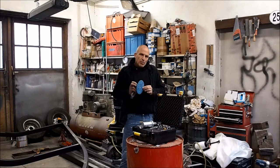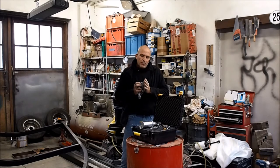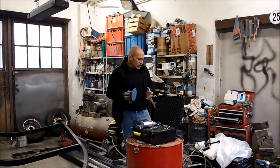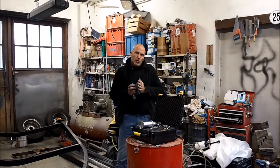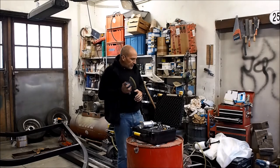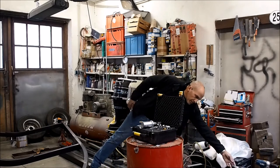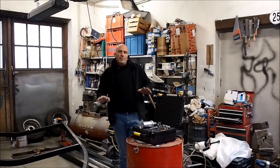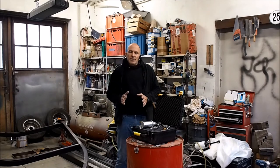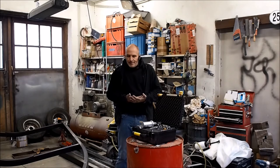If you want to be super cautious, you can actually use two of these foam pads. They are normally like 8 to 10 millimeters, at least what we can get here in Germany. So sometimes I put two on top of each other and then put the sandpaper on top of that. So if I manage to sand it down, get my flat surface at 360, that's the point when I put on my last layer of clear.